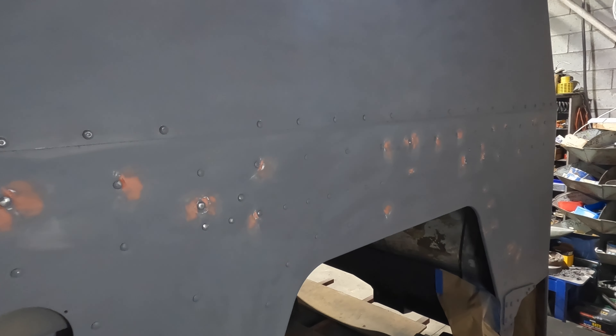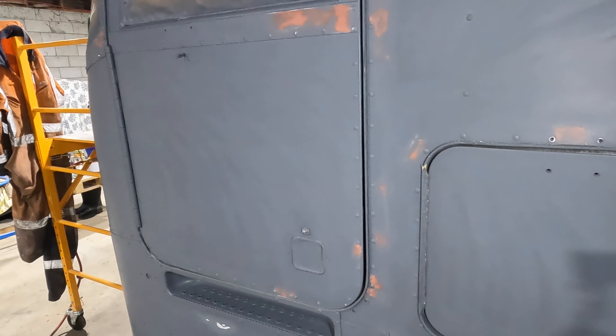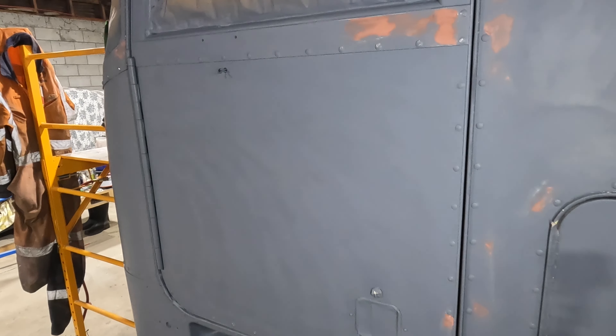I worked away at the primer side of it. At the end of the week I realized I hadn't got it right, and my mate came here and looked at it — so round two. The cab's all been rubbed down. I've put my glazing putty on what I could see had shown up. I don't doubt there's gonna be a few imperfections in it, but I can live with that. You can see the lines on there where I've wiped it down with the wax and grease remover.